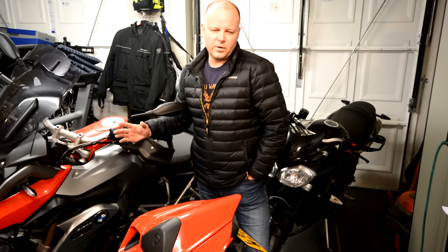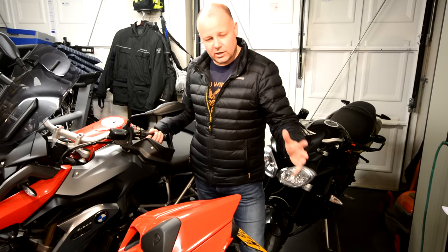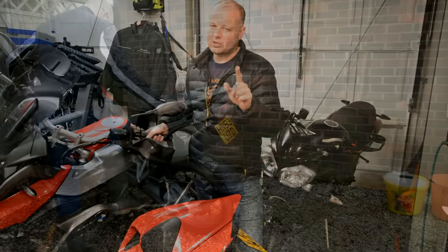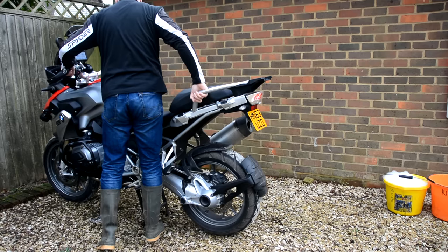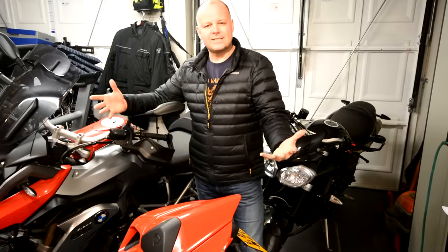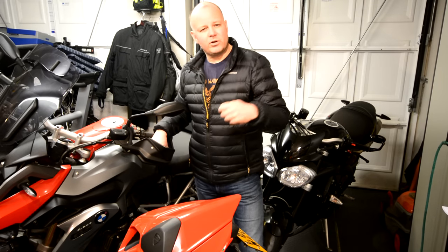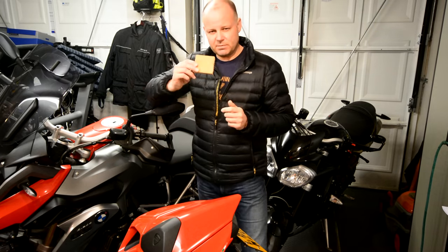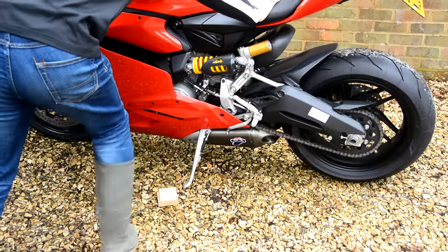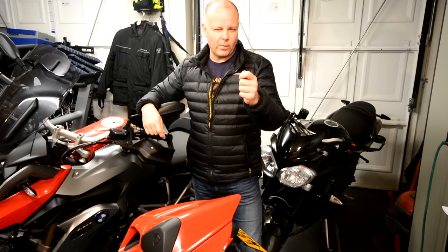The first thing I do when I'm going to start cleaning the bike is get the bike outside — unless you happen to have an indoor washing area, which is very unlikely. Get the bike outside and get it vertical. If the bike's got a centre stand like the BMW, stick it on there to get the bike properly vertical; that way all the suds run off properly, gravity does its thing and helps you rinse the bike off. If you don't have a centre stand, get the bike on a paddock stand or an ABBA stand. Or if you're lazy like me, stick the side stand down, put a couple of blocks of wood under it and get the bike vertical — just be a bit careful as the bike becomes less stable on the non-stand side.